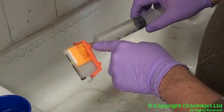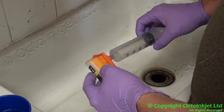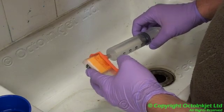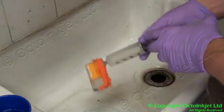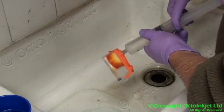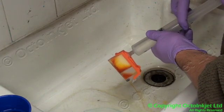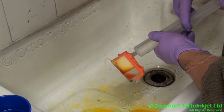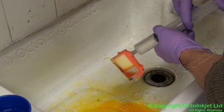We've put the syringe onto our clip. This particular cartridge is still sealed, so all the ink is going to come out through the vent hole here — sorry, the ink and the water is going to come out through the vent hole. So over a sink, obviously what you're doing is just gently forcing water into the cartridge. As you can see it's coming out of any hole available.